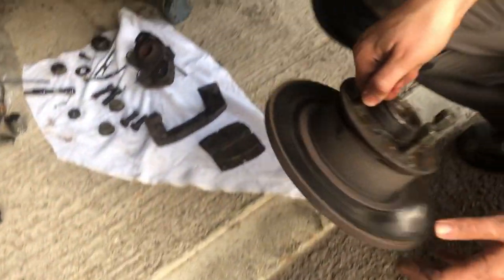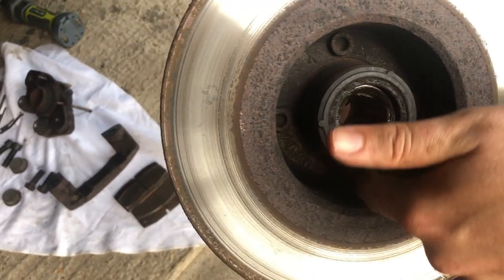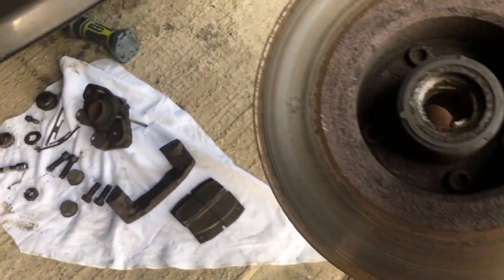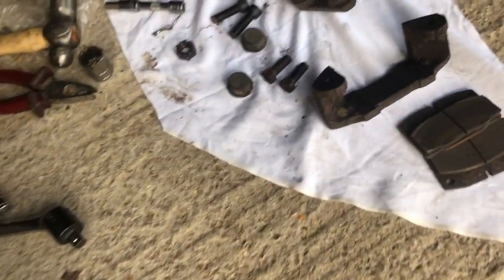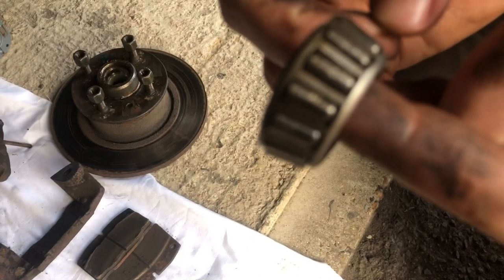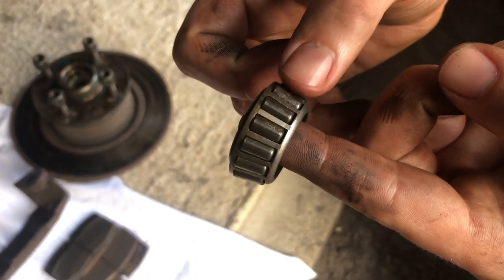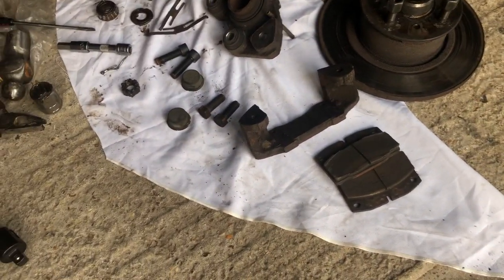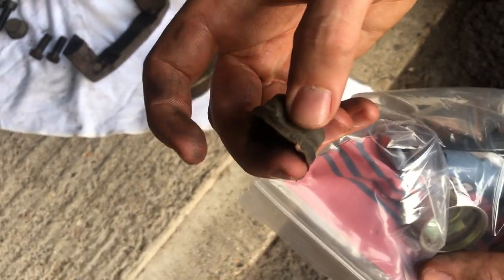Sam's got the old disc. We've pulled that off, so we've got to separate the hub unit from the disc — you can see it's just bolted in from the inside with spline drives. The rear bearing sits in there and the outer bearing just sits in there as well. They're going to need all cleaning up. Look at the surface of those rollers — it sounded terrible on there, awful. Good job they're coming apart because that would have rumbled like a good one. We've also got a nice new kit for all the spare bits — new seals for the calipers, new caps. I actually split one of the caps coming apart, so a new one will be handy.